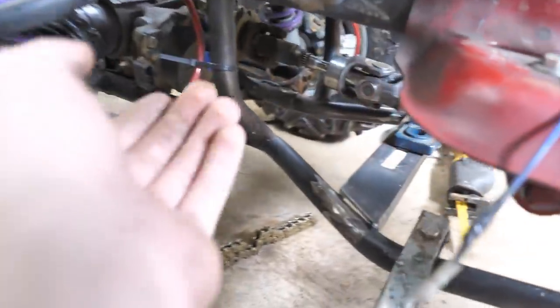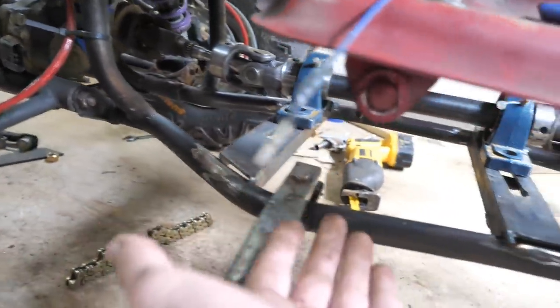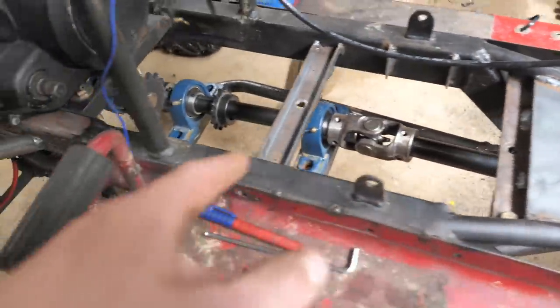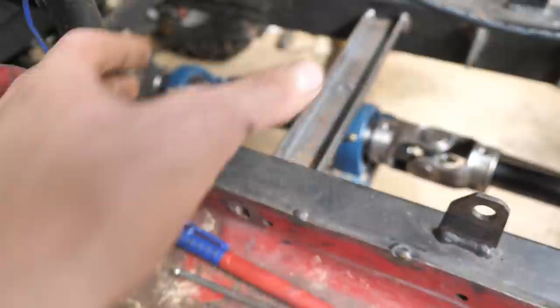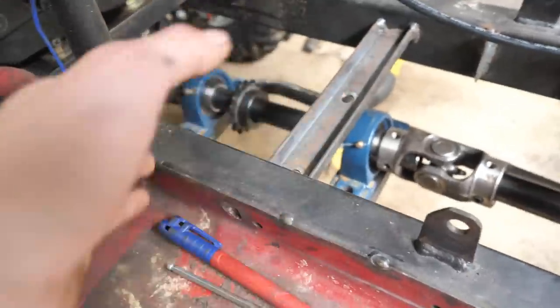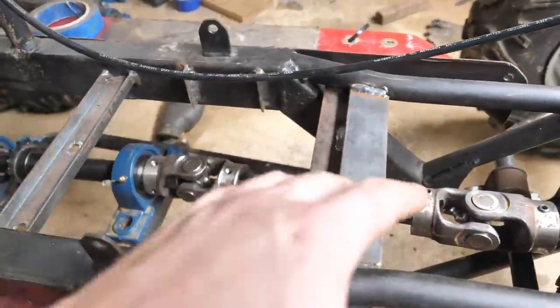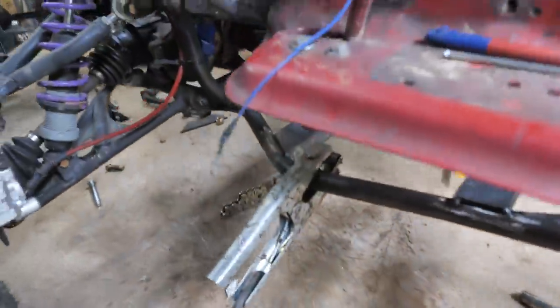I tell you what guys, since we have no huge clutch in the way, it is a lot easier to set up the drive shaft. We have a total of 4 U-joints, and that's needed because I need some way to adjust the tension on the drive shaft in case we have to do quick gear ratio changes. We're going to make sure to clock all those properly and add a few more supports, so the whole bottom of this mower will be supported and triangulated.